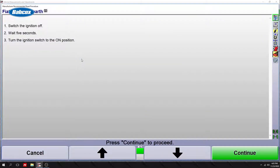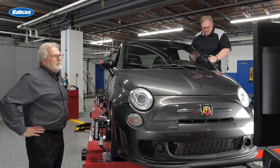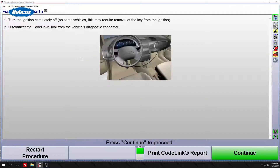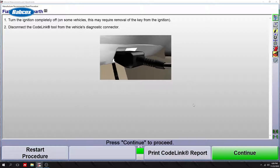It's come back now. Once you turn the ignition switch off, count to five and turn the ignition switch back on. K for continue. Do a final read. Turn the ignition switch off and disconnect the scan tool.